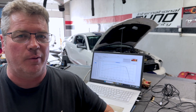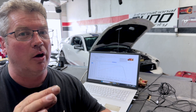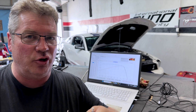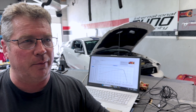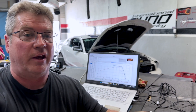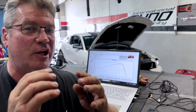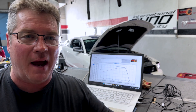On this channel we talk about fueling an awful lot, so when a customer comes in most of the time they're not up to date on the terminology. When I say it doesn't have any fuel, the customer says they just filled the tank. What we're talking about is electronically adjusting the fuel system — the amount of fuel delivered to the injector and how long the fuel injector stays open — to change how much fuel is delivered during a combustion cycle. Basically, we need to give the engine more fuel so it makes more power. Some vehicles have too much fuel and we have to take fuel out. We're always getting the correct amount of fuel into the combustion chamber to match with the air so it makes the most power it can, but safely.